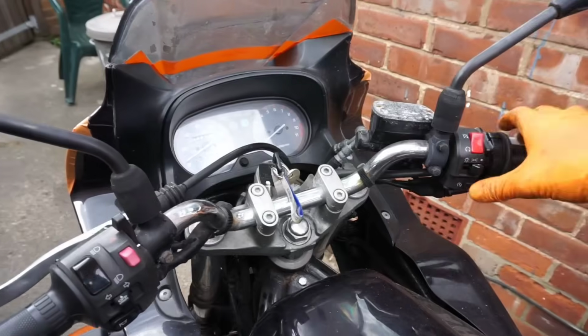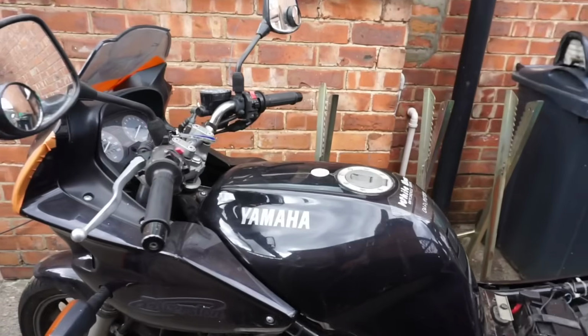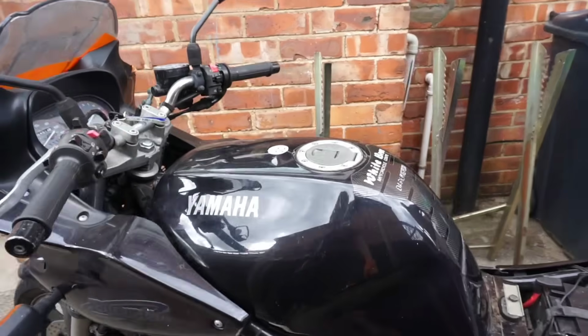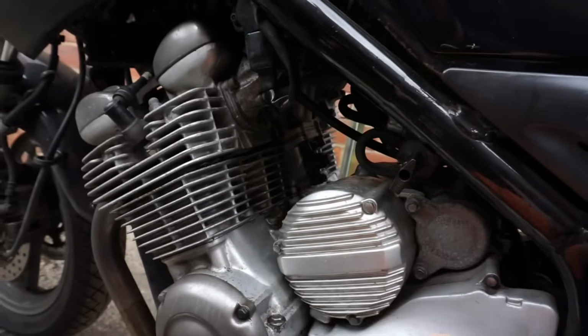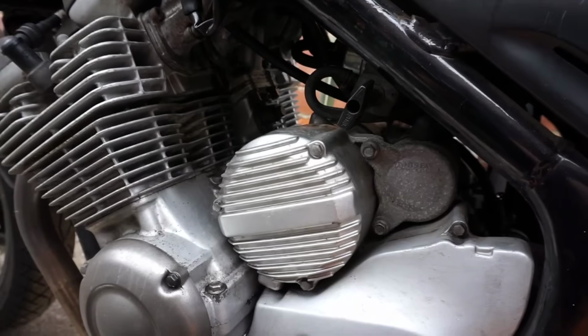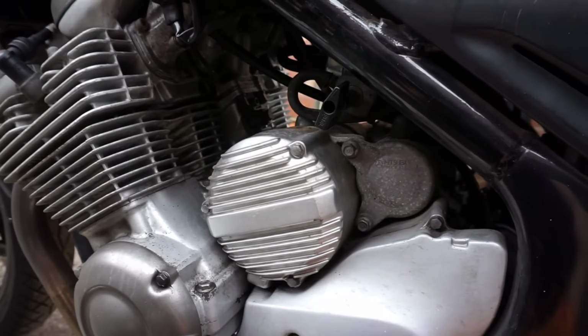Yeah. Is that what they choke? Yeah, but I think it's still saturated, so we're getting rid of most of the water. Okay. It's just obviously getting enough petrol to it, you know, to ignite. Yeah, when it's coming out of the tap there, it's almost like cloudy. It doesn't look that bad in the tank though. It's what threw me a little bit, because I thought that looks alright actually in there, but yeah.